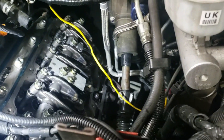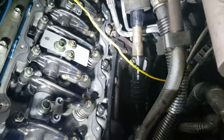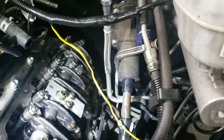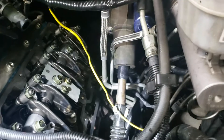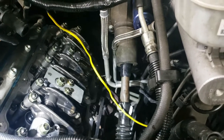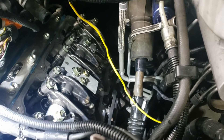We're back working on the driver side. The valve covers are off, the injectors are out, and it's pretty much ready to reassemble. The wiring harness is laid out over the side of the truck. This side is definitely harder than the passenger side — the little allen head bolts on the back end are really hard to get to because of the steering shaft and fuel lines right there. I went through a few different extensions, knuckles, and regular allen wrenches before finally getting it.